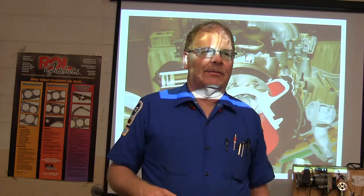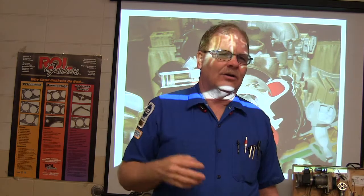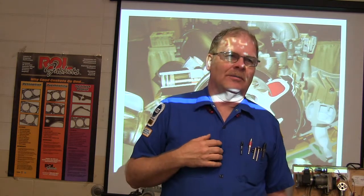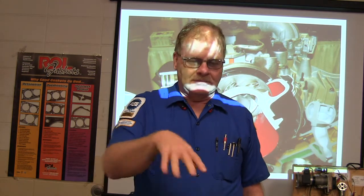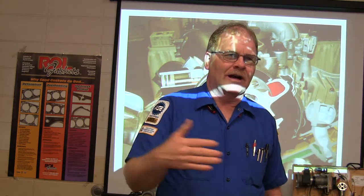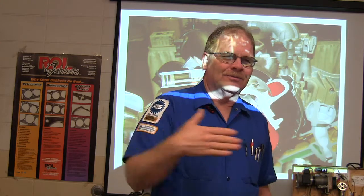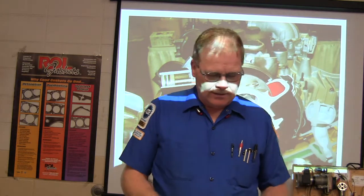She was in traffic, and she hit the brake, and the thing went into a spin, and she had a big nasty crash. It didn't hurt her, but it tore the car all to pieces. They told me to go look at it and see if I could figure out what had gone wrong with it. I went to the salvage yard, they had it in their boneyard, and I could see that guy had changed out those tires. It had bias ply tires on the left front and the right rear.